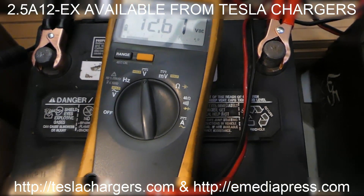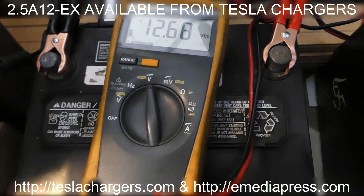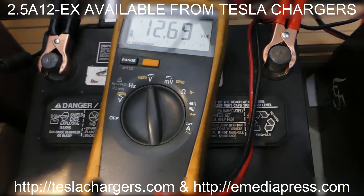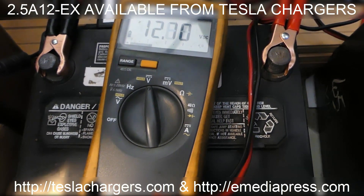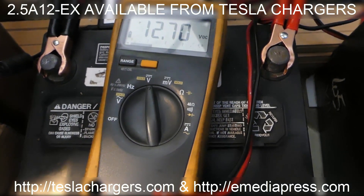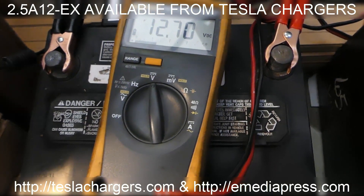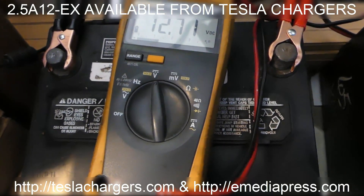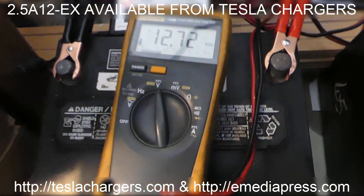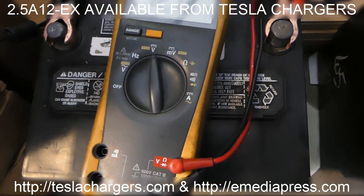Once it gets over 16 or so, little by little it will start coming down into the 15s, maybe the high 14s, and when the charger senses that the sulfation issue is solved — based on how the battery responds to the voltage — it's a pretty smart charger. Then it's going to slowly push it right up to about 15.3, the topping charge kicks in, the green light comes on, and it's done — back to like new status, or at least as good as it's going to be for its particular condition.